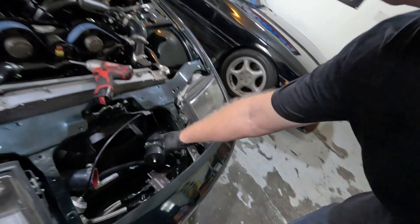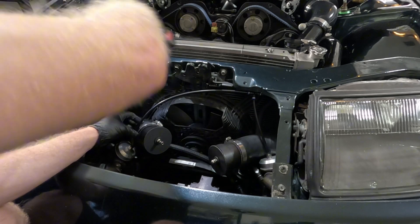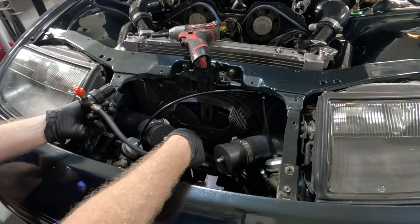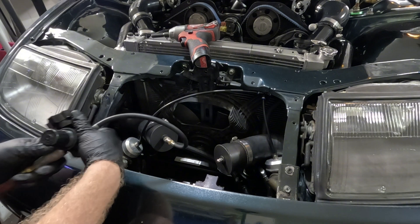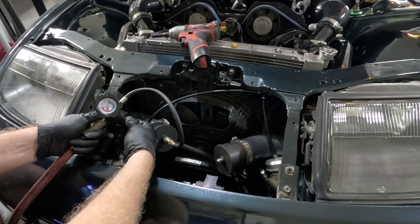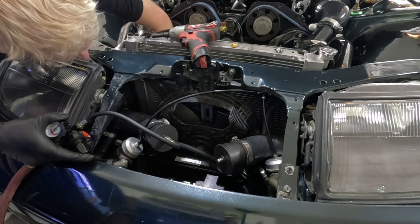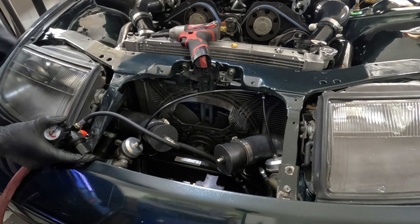Anyways, I got one side off for the air filter, I'm going to plug in the other side, hook up the air hose, and we're going to pressurize the system. Pardon the background noise — I had to turn on the fan. So we got this plugged in. Now, slowly adding in some air... there's definitely a leak in there. Yeah, that would explain it — the piping at the turbo is not even tight.